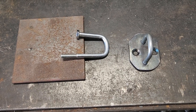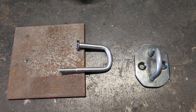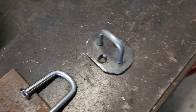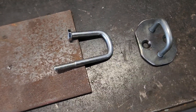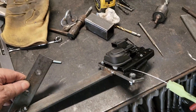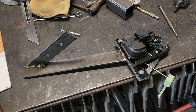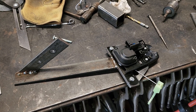I had to make my own striker plates. Basically, I took a quarter-inch by six-inch bolt and used my 20-ton hydraulic press and pinned it. I fabricated a bracket to bolt the catch in, and I made it so it could be removable if I have trouble getting the body off, as I have in previous builds. So I'm going to work on a two-inch bolt so I can take these out if I need to.